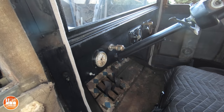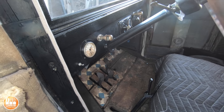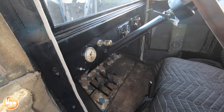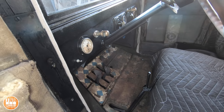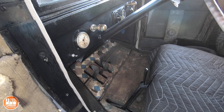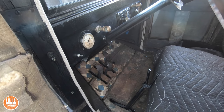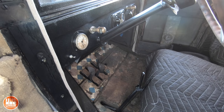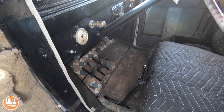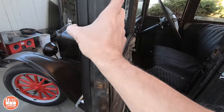While we're in here I'll talk quickly about the starter. In my last update video I did a cold start, and people noticed how slow it cranks. I hand-crank it to prime it just because it cranks so slow. Several people said I should replace the battery or check for a bad connection — of course I did all of that. The battery's brand new, every wire is brand new, all the cables that run to the starter and battery, everything's new, and all the contact points have been extremely well cleaned. So while it's possible it's a bad connection, it's not really likely. It could be that the starter needs to be rebuilt — it didn't work at first and I cleaned it up a little bit to get it going. Or it could just be that because it's a six-volt system it's going to crank over pretty slow. I don't have any other point of reference with six-volt systems — I've always had 12-volt, and even the 356 I'm converting to 12-volt. So it's very likely that it's just normal for a six-volt system. If you guys know more than me, please let me know.